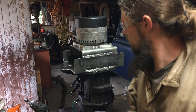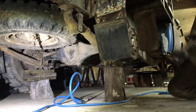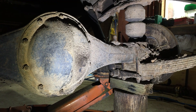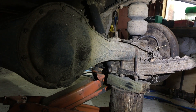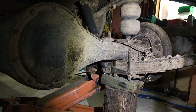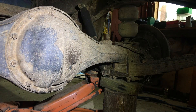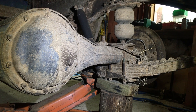I reckon lunch is the next step. Lucky I cleaned it under here — that was a good job. Anyway, I'm going to pull all the brakes out because they're leaking, and this is a great opportunity to get them all sorted. That's a bit of a delay on the EV side of things, but it needs to be done, so let's get it done. Let's get the diff out too — there's a bit of lash on the diff, it's a bit sloppy, and the oil seal on the diff is leaking. I've got spare seals on hand. We'll service this back end. The whole drive line is going to be fresh as a daisy by the time we're done.